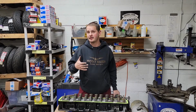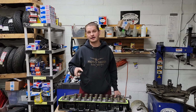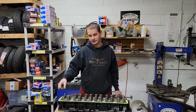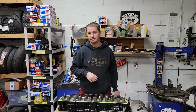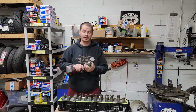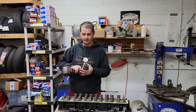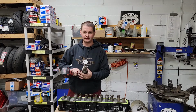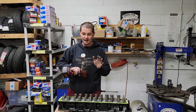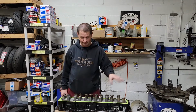I wouldn't intentionally leave you guys hanging. So this morning I came in, this is the day after I painted it, and I pulled the three valves where, when it hit the floor last night, it actually cut the plastic that I had covering it, and you could see where those three valves had actually hit the concrete. So I pulled them and I put them, and this is not the correct way, I'm 100% sure, but I've chucked them into a drill just past where the keepers go. And all three of them spin almost perfectly straight. I would say well within thousandths, they're probably this way when I took it apart. So I am going to say that I didn't bend any valves and that I can finish assembling the head and swap my springs out and we'll be okay.